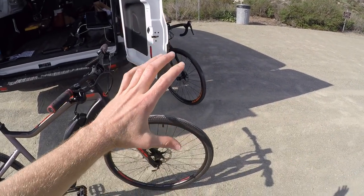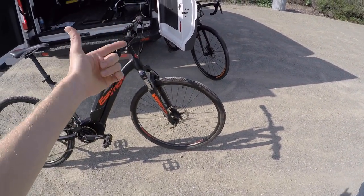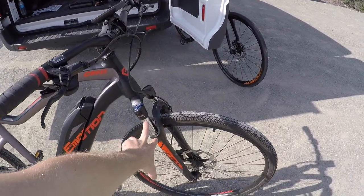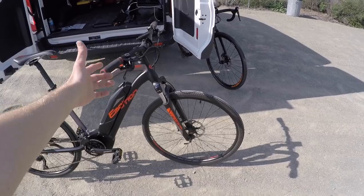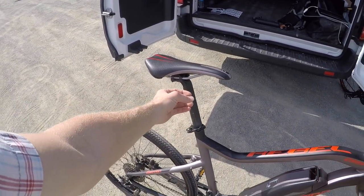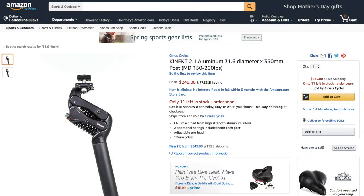This is a little bit more efficient tire — so the air volume and surface area is somewhat limited, and that's efficient, but a little bit less comfortable. 63 millimeters of travel versus maybe 80 or 100. And then a hardtail. This is 31.6 millimeters on that seat post. You could throw on a seat post suspension and get a little bit more of a full suspension feel — get yourself a body float suspension seat post. It's going to change the whole ride experience.